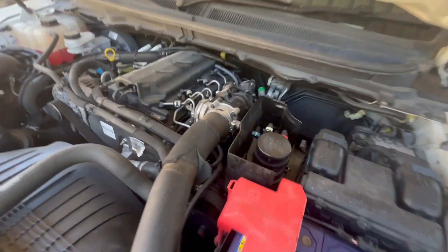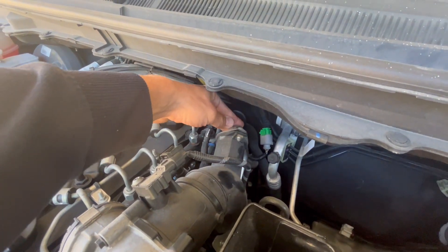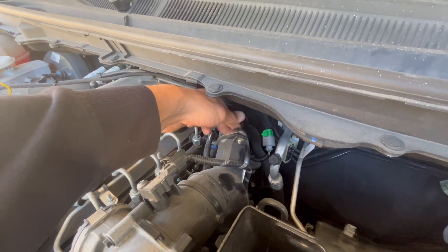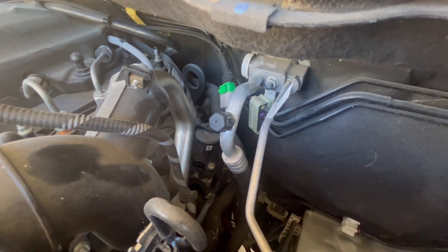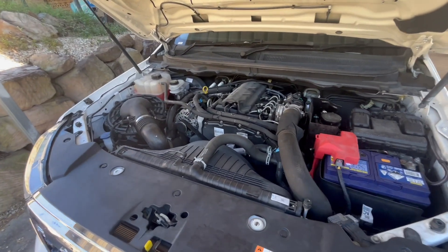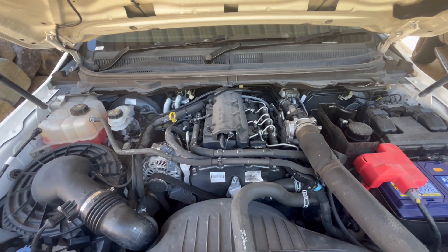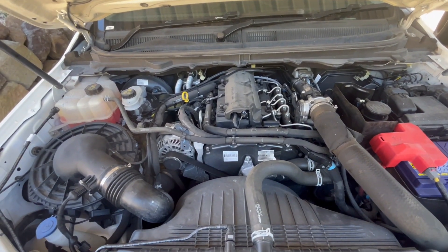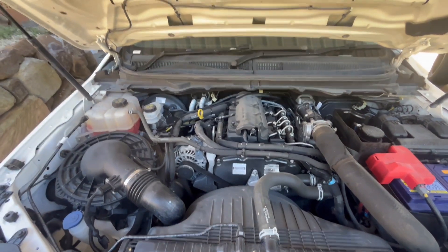I've just come back from a drive and I can put my hand on that pipe — normally it would be too hot to touch, but obviously the EGR valve is staying closed and it's actually cool to touch. The valve itself is disconnected. I would highly recommend this product: very easy to install, it's all just plug and play, and from the road testing you saw in this video, everything works exactly as it should. So until next time, see you guys later.